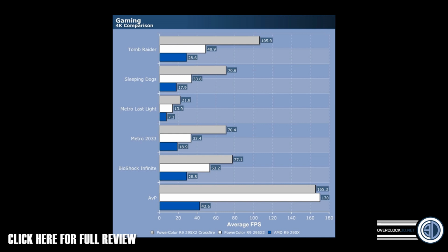We've not been able to get, for argument's sake, any of the Origin games to run. So Battlefield 4 just errors. It gets a DirectX 11 error, and we have to run it in DX11 because it's the only way we can record the frames per second. If we disable one card, it starts up fine. So it's definitely the fact that there's the two in there. Yes, we could just do a Mantle run, but if we did just do a Mantle run, then we couldn't tell you how quick it was running. So it is a complicated thing.